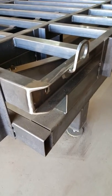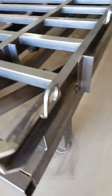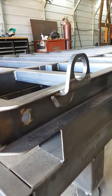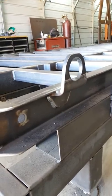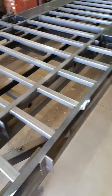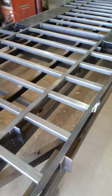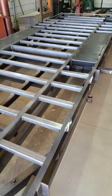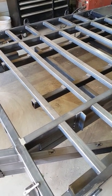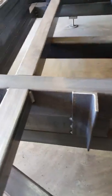Front tie-down points — this is a new design for this year, a folded design. Moving along, we've got a lot of cross members. We add these for the full tread plate to support it at every foot. They're two-by-two square tube and get welded on the sides.